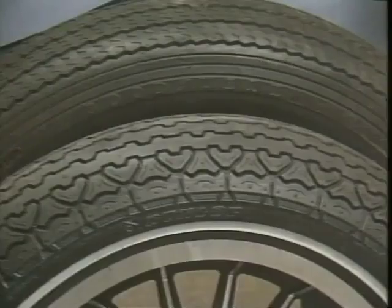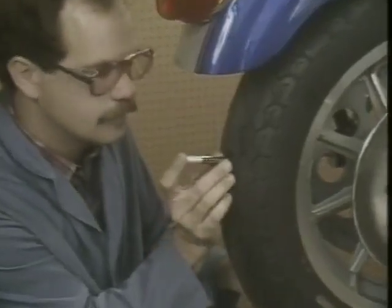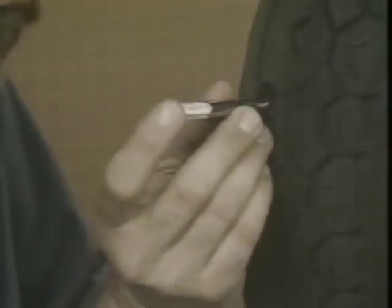When changing only one tire, you must consider the remaining tire to make sure that the new tire is compatible with the remaining tire. Also, when fitting a new tire, you must be aware of the condition of the other tire. Are the tread depths and styles so different that handling could be affected? Whenever possible, change tires in pairs, and always tell the customer what you found.